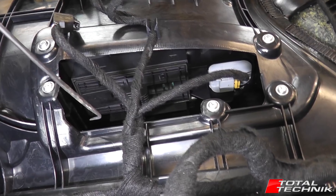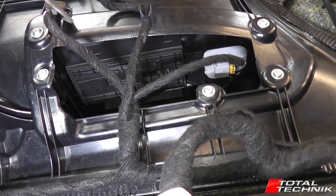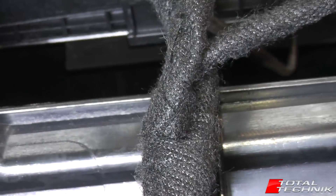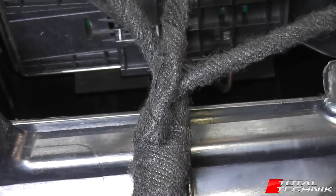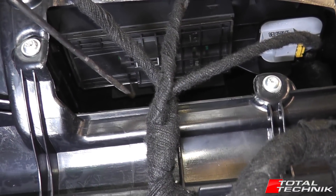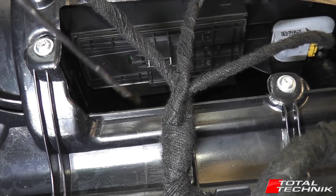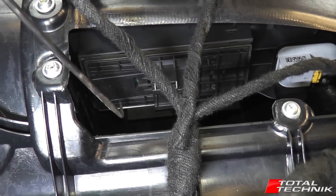So I'll keep some downward force on these whilst I'm working on releasing the barbs. One of the things that helps us get this switch out: if you look on the back, you've got almost a plastic plate that runs about two thirds to three quarters of the width of that switch. We'll be focusing on disconnecting the rear first because we have worse access to the rear, and then releasing the other two on the front will be simpler by comparison. We need to attack this plate whilst putting some downward force on the tops of the switches with my thumb from the other side.